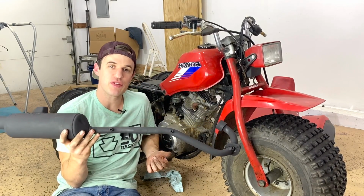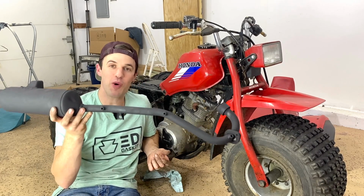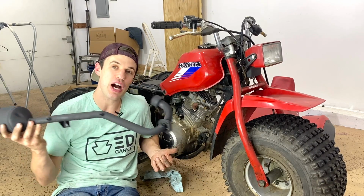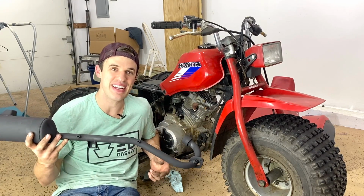So after 3 hours of dry time, this thing is ready to handle. Now the next best step to make sure the paint is durable is to put it in the oven at 400 degrees for a half hour, then let it cool, and then put it back in the oven at 600 degrees for another half hour. Now that's completely impractical for most of us, so I think I have a better idea.